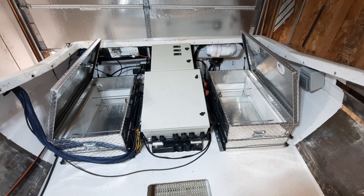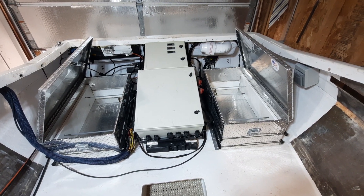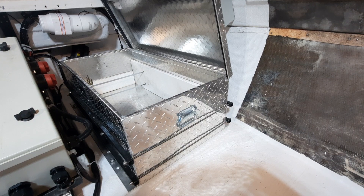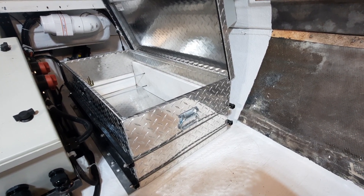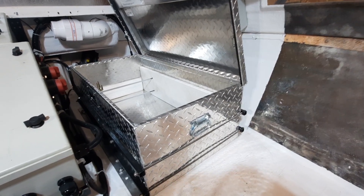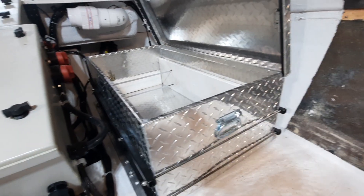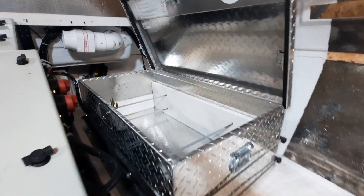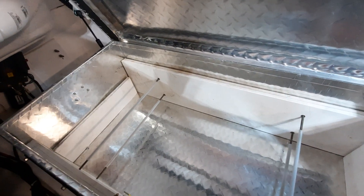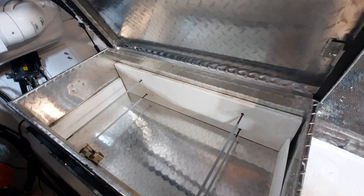The latest thing I did back here was install the battery boxes. That was all prepped but still took a while to get organized. There's a fair amount of debate on whether lithium iron phosphate cells need to be compressed or fixed in position — in a moving vehicle they've definitely got to be at least fixed or your terminals are going to loosen up. I've got half-inch square tubing running the length of each side, quarter-20 rod on the outside, two quarter-20 rods on the inside between the batteries, with compression provided by one-sixteenth aluminum and half-inch PVC. So I think we're going to be compressing the batteries a little bit, and that's probably a good thing.